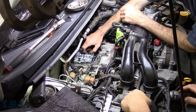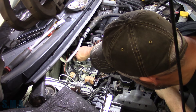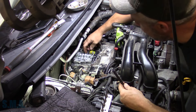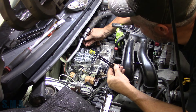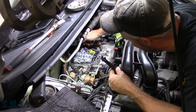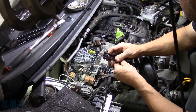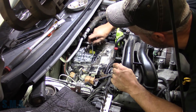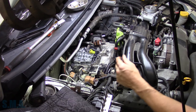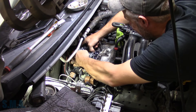Jay's working on pulling the bolts. How do you know which bolts to pull? Well, you look at the new valve body — take out all the black ones, and then there are two silver bolts. It also tells you in service data which ones to pull. There's a silver one right here and then this one here. I believe they're all the same length — the black ones are anyway. We'll double-check as we go along. The silver ones are both the same, so that's good to know.